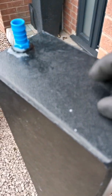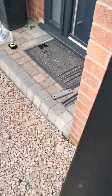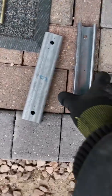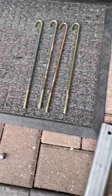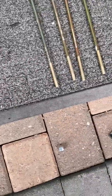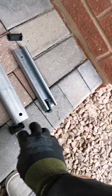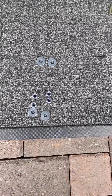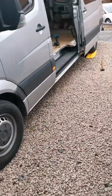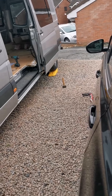I've got my waste tank here — the inlet is 40mm, which is wider, because I'm going to connect the shower and the sink to it. It will connect to the drain hose to drain the tank. When you get them delivered, the fittings aren't pre-installed — that's a safety precaution for postage. I've just fitted that in and put a load of Sika Flex around there to keep it secure. These galvanized brackets won't rust, which is good.